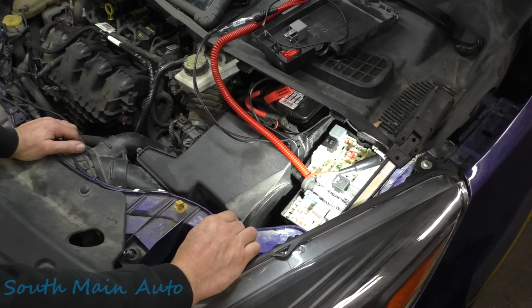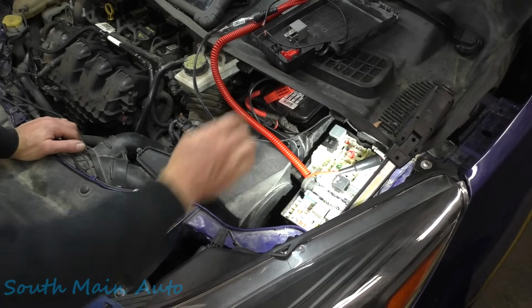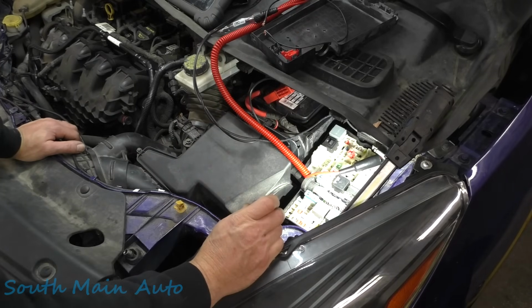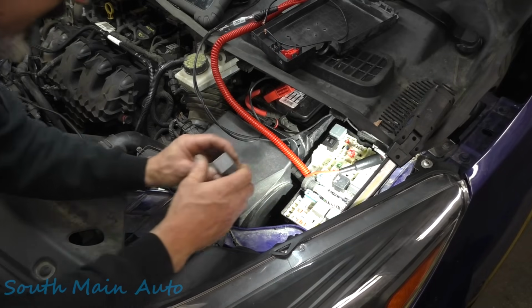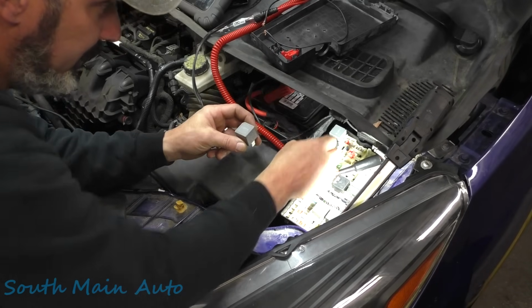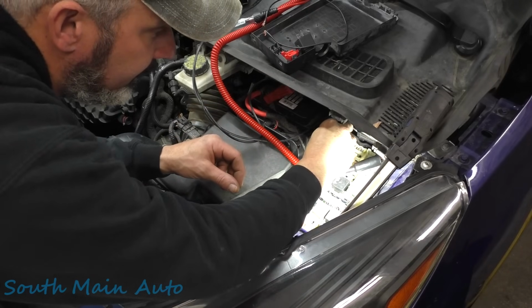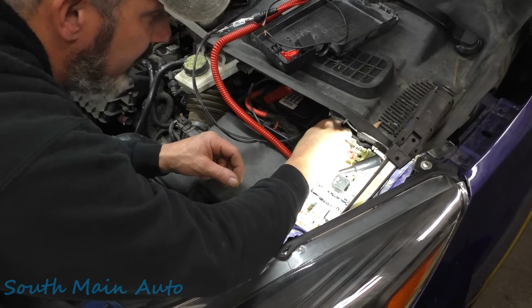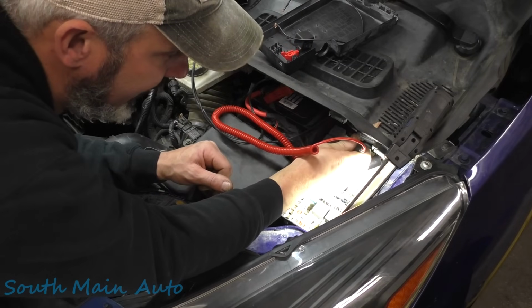Let's change all of our focus from anything we were thinking to what controls the ignition relay. What turns this on? We know a couple things. We know this relay is good, because we jumpered it when it was in here. Let's put that back in there. Let's take some of the facts that we know, if we apply a ground to the control side.